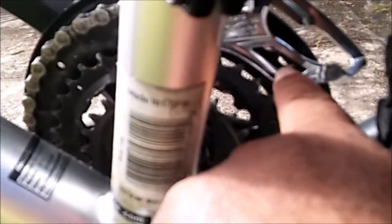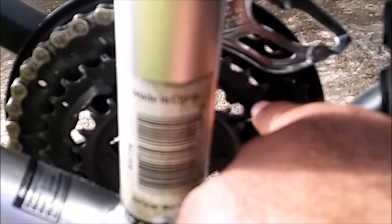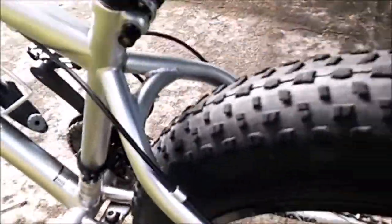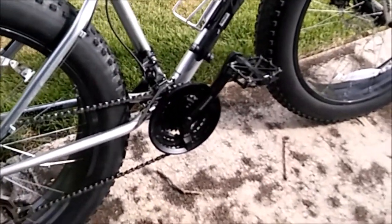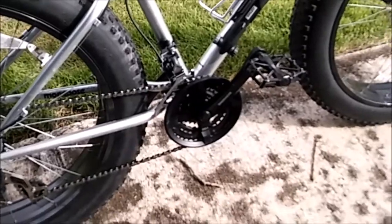As you can see, when I had the derailleur mounted the proper way and was shifting from second gear to third gear to the larger ring gear, this piece was rubbing against the middle gear — the second gear. Because of that I couldn't mount it properly. I had two choices: cut it with a Dremel tool or just mount it higher the way I did. I decided not to cut it because that might affect the structural integrity of the derailleur.